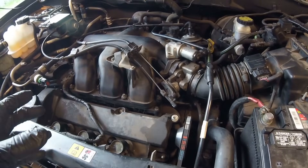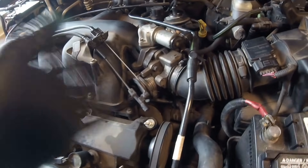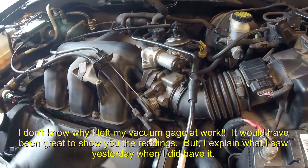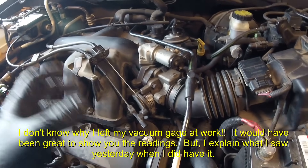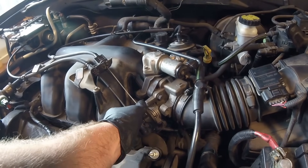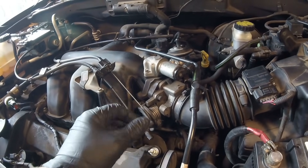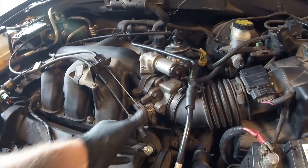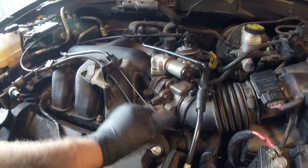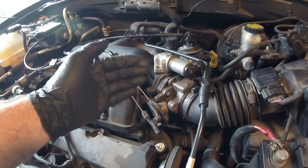I'm going to go ahead and crank it up and let you listen to it and see how it's running. So I got it running for you. Unfortunately I didn't bring my vacuum gauge with me today, but I hooked up the vacuum gauge to one of the lines going off the intake here, and at idle it had about 12 inches of vacuum. Just off idle, when I rev it like this, it was actually worse than this yesterday — the chunks of the catalytic converter moved around and it's actually breathing better than it was. But whenever I rev it up, it held it right about there and you can hear it doesn't sound right.